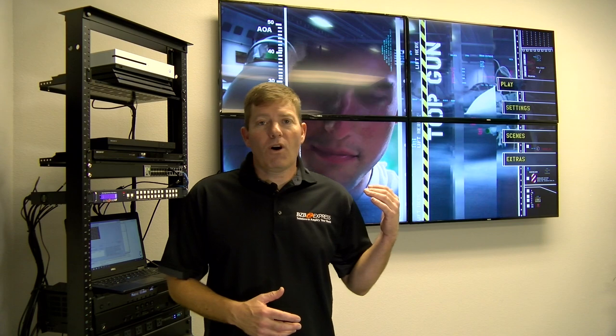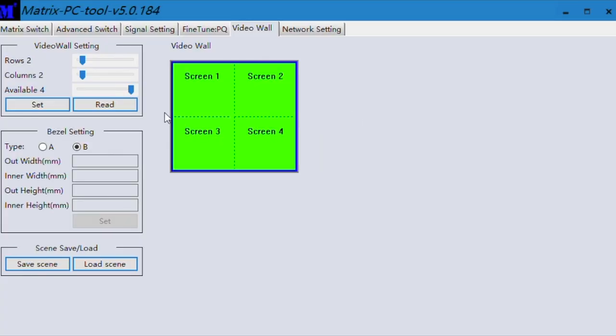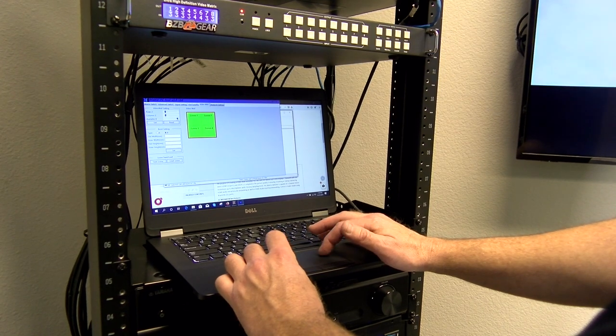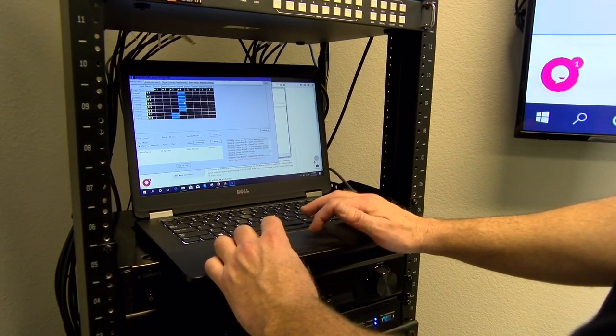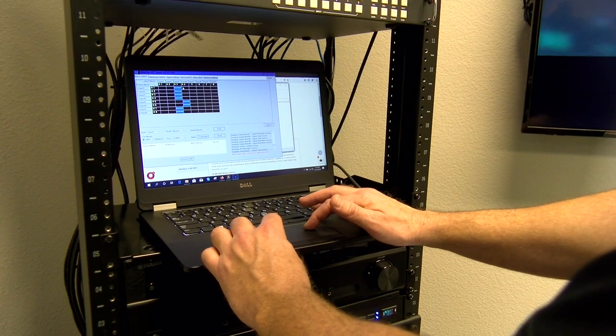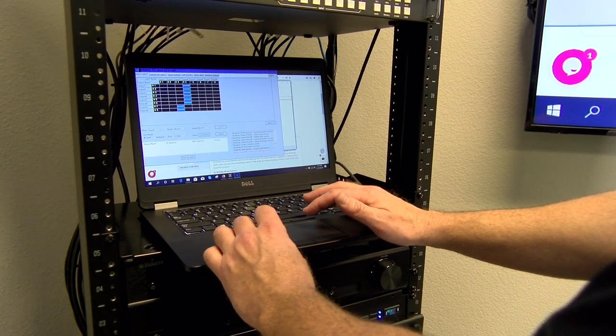As you can see, we've got our video wall going. I'll show you a few of the settings and configurations you can do, and how to navigate through the RS-232 tool. These are your rows and columns that you can adjust depending on your configuration layout, as well as bezel settings including pixel settings. You need to calculate that by measuring the inner frame and the outer frames, and how many TVs you have. Then you hit Set. You can also select all four outputs at once when changing inputs — for example, selecting input four will prompt a confirmation, and then it moves all four outputs simultaneously.